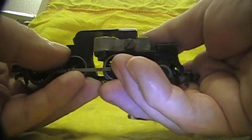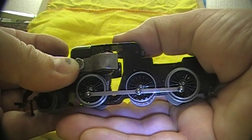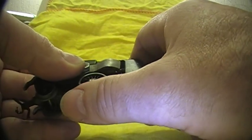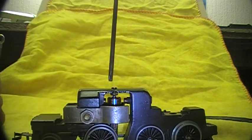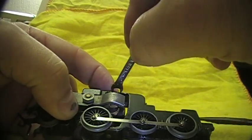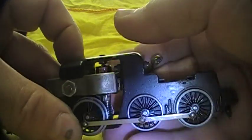If there isn't just a small amount of end play in there, it will start getting tight. So you can just rock the wheel backwards and forwards and look for the tiniest amount of movement. This has got not even half a millimeter, so I'll just give it a fraction more clearance. You just undo the nut and unscrew it just a fraction, then nip the nut up again to try it. There is just a little bit of movement in there now.